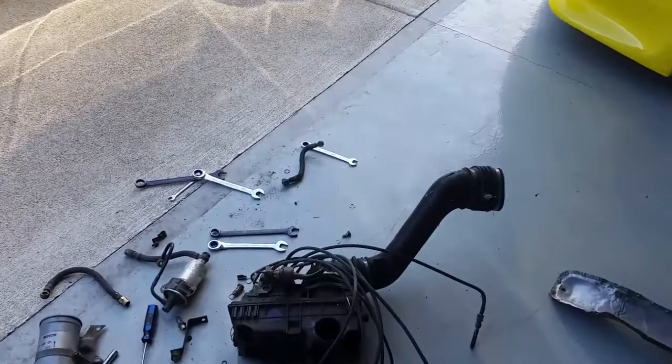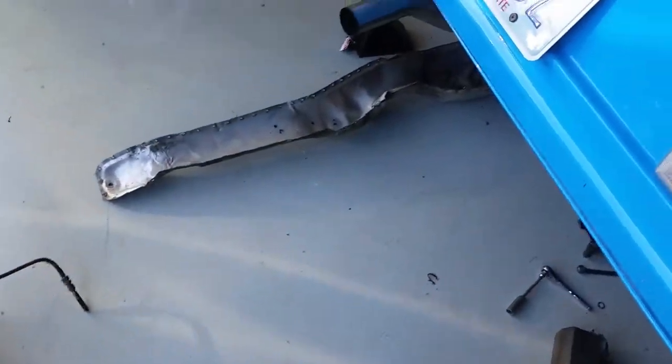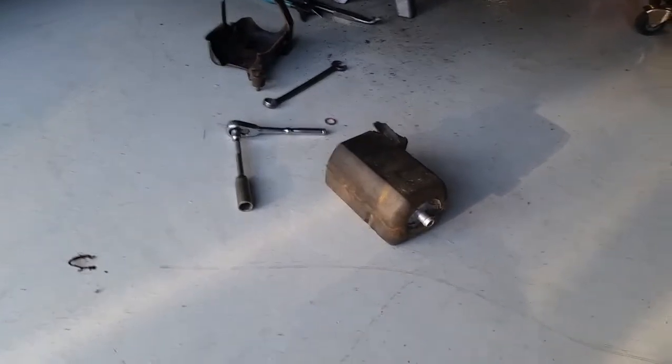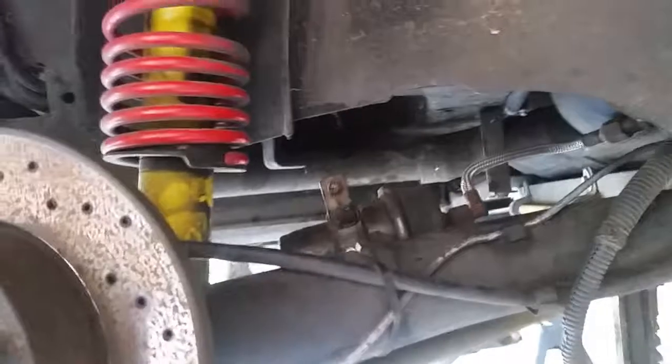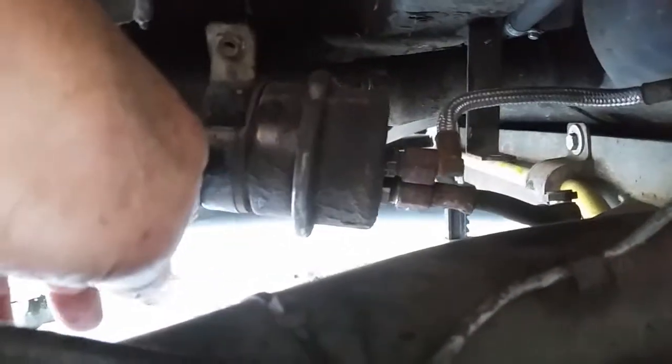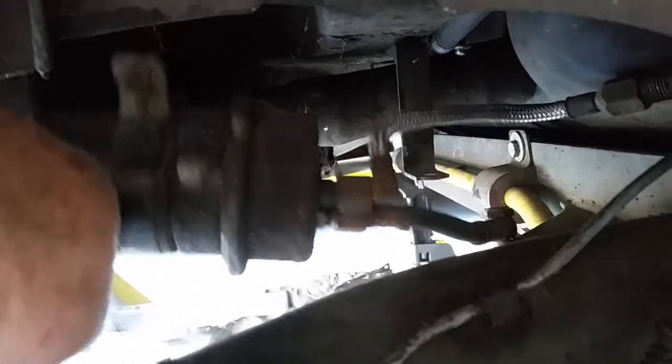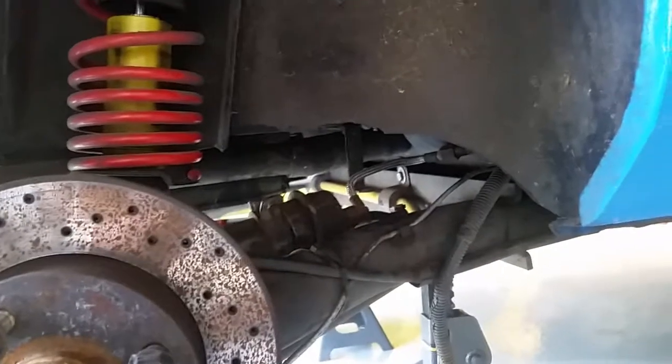And what I'm doing right now is I'm trying to get the fuel pump and stuff mounted in there. So I'm coming up with a couple of different configurations for the fuel pump. And the accumulator. Let's see, which I'm going to be sticking right up under here. There's part of it. There's the accumulator. And then the other side of that will hook to the pump. I just gotta find a good place to mount it, and then I think that part will be done, and then I'll have to worry about a fuel filter up underneath the engine bay somewhere.